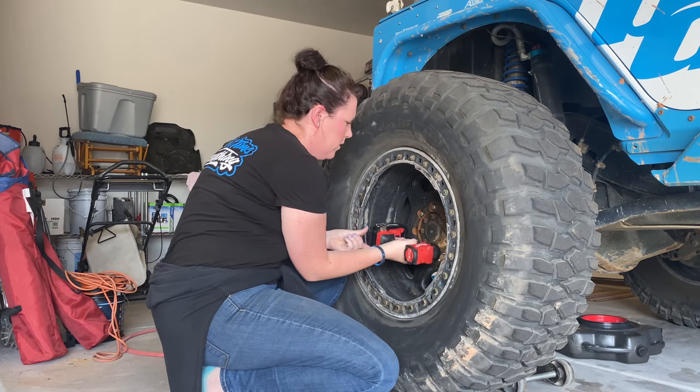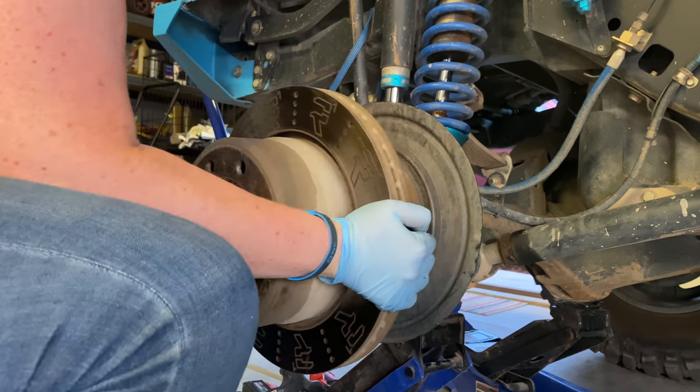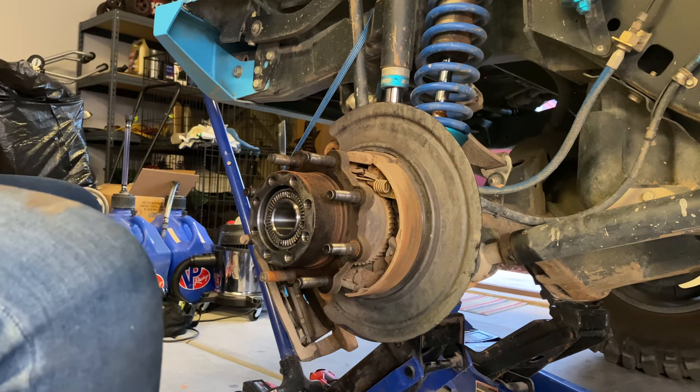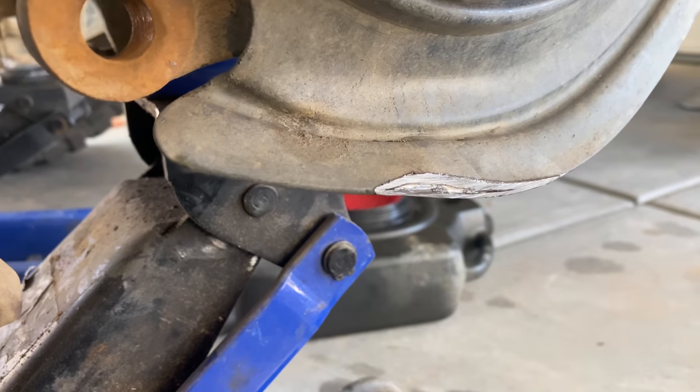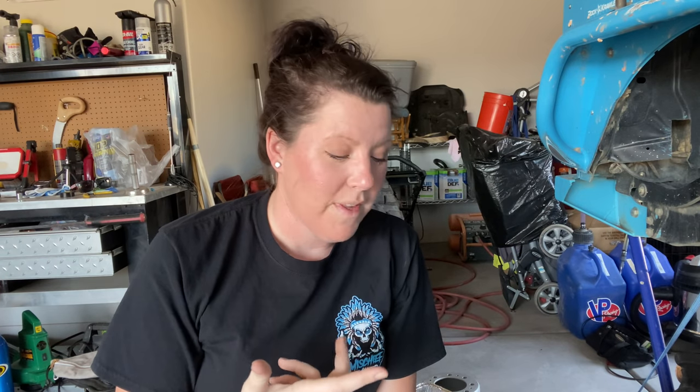Last night, I decided to take the wheel and tire off, took those bolts off, took the brake caliper off, and this is what I found. The dust shield is actually bent a little forward. You can see where it's kind of been scraping against the rotor. Check the little rotor out. So we know that the squeaking was coming from the dust shield — obviously it was bent in on the rotor. Thank goodness.